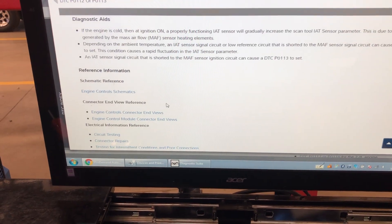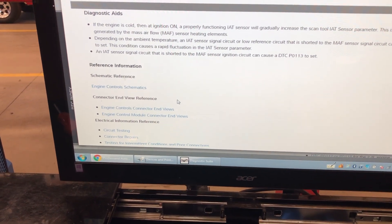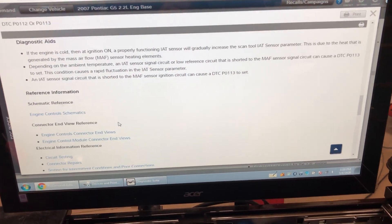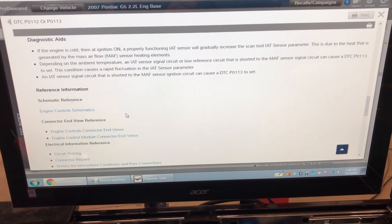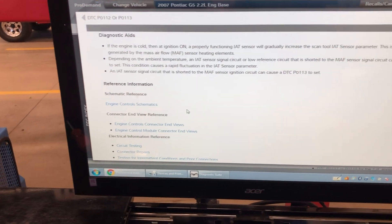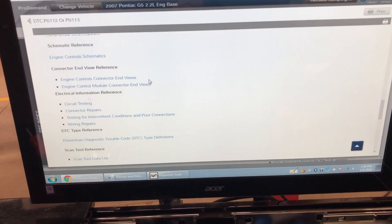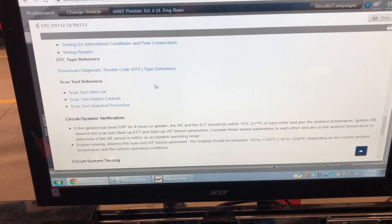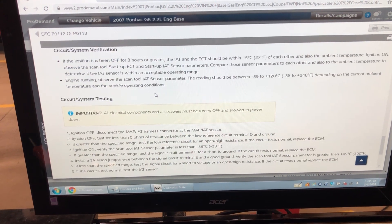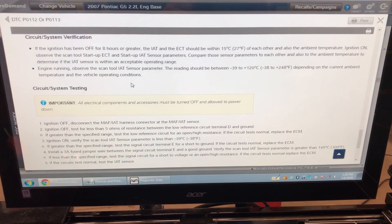The computer didn't dump a whole bunch of fuel and get fooled — and even if it did, the oxygen sensor would have picked up that there was way too much fuel and backed it off. It turned the light on because there's no way it's minus 40 out. It tried to run under minus 40 conditions and it ran horribly. It had lots of data to say something was wrong.